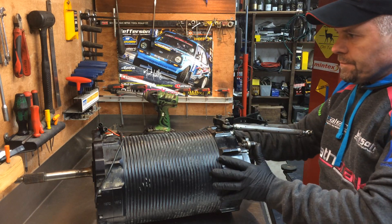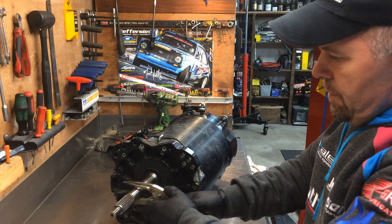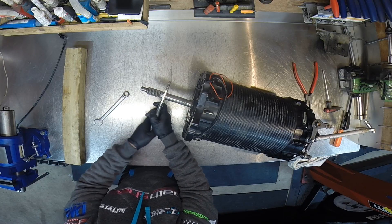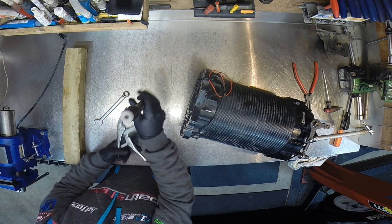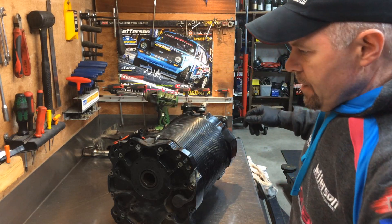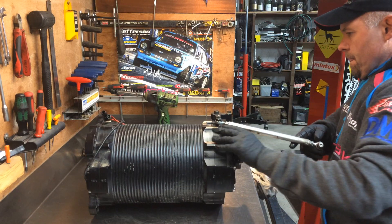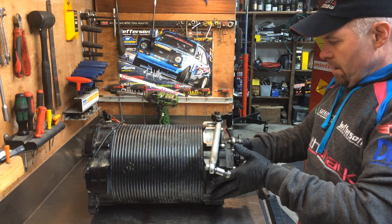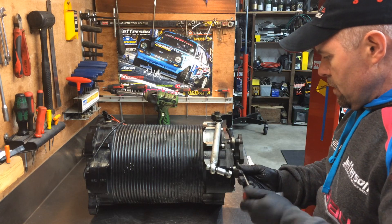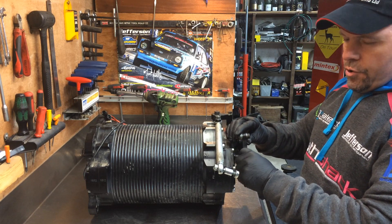I've already taken the gearbox off the back — that's the bespoke gearbox mounting — and drained the oil overnight via the drain plug at the bottom. You can also take out the input shaft; in these it usually takes a bit of a grip to get it out, but it slides in a bit like a driveshaft into the front of the gearbox. You can use different input shafts for different types of gearing. Some people worry about a bit of play in the front of these transmissions, but they're just on a plain bearing so there's going to be a bit of play — it doesn't cause any problem. At the back we have a row of 6mm Allen keys and a 5mm on the selector mechanism, so we'll get that off first.